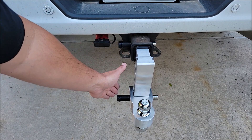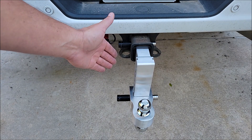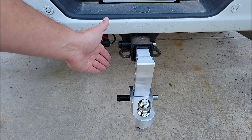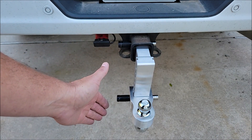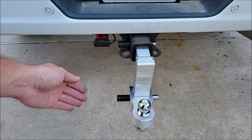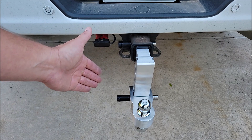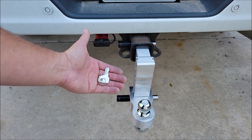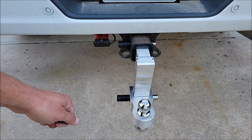There is a massive amount of adjustment here, which is what makes these type of hitches great. So if you have a lifted truck or a truck that sits really high, these are a must. Overall, I really like this tow hitch. I use the two inch and the two and five-sixteenths ball all the time. The ratings on the hitch are more than enough for what I need to pull, and the build quality on this thing looks awesome. I love the fact that one set of keys operates both of the locking pins — it's everything I'm looking for.